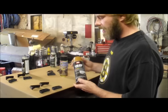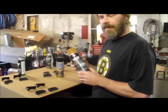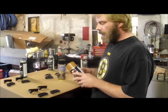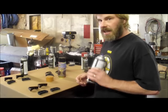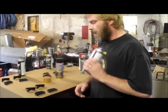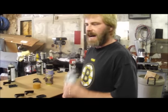The SEM color coats can be used on vinyl but also on metal and plastic. It's an aerosol-based dye. Shake each can up real good for about a minute, then feather coat on about five coats of dye, and then we're going to apply a little low luster clear coat.